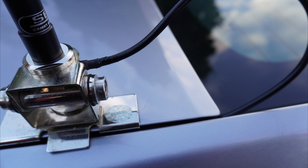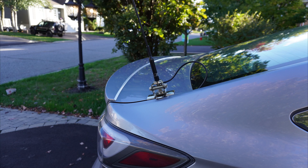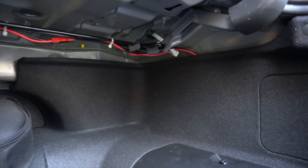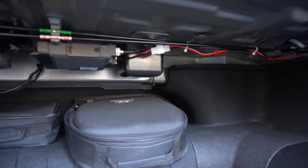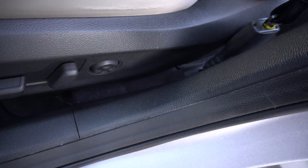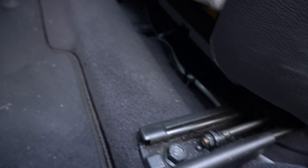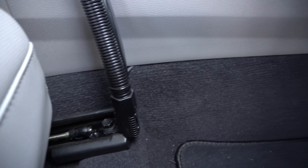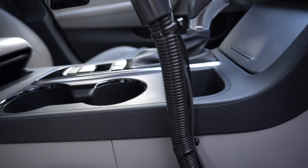Here's the final result. You can see the electrical liquid tape I applied over the shrink connector to prevent water infiltration, since it's facing outward. The automotive goop has dried and everything looks solid. It's very clean, just the way I like it. With items in the trunk there's no risk of hitting the radio. The wire passes between the seat and the back — about two inches thick — then runs under the trim up to the front, goes under the seat rail (it's an electric seat so it moves, which is important), then through the trim around the center console to come out the other side on the bracket, with everything secured by zip ties leading to the radio.